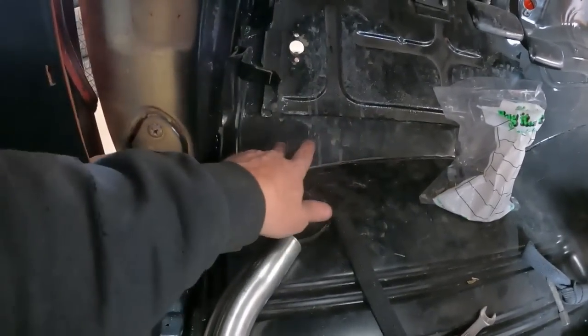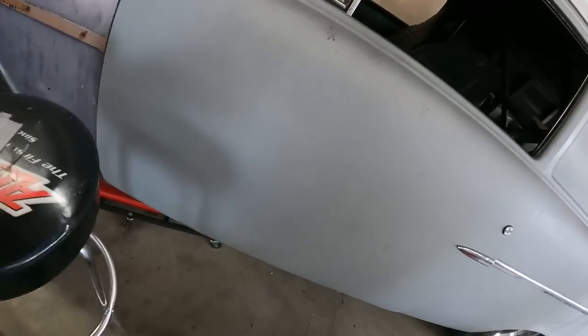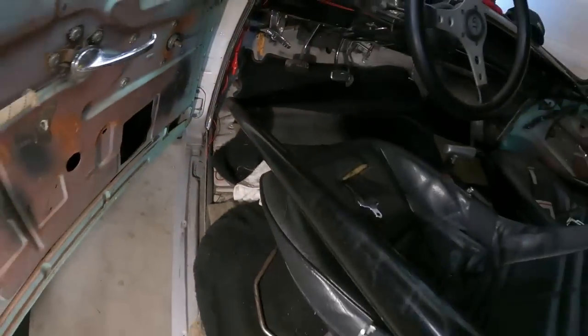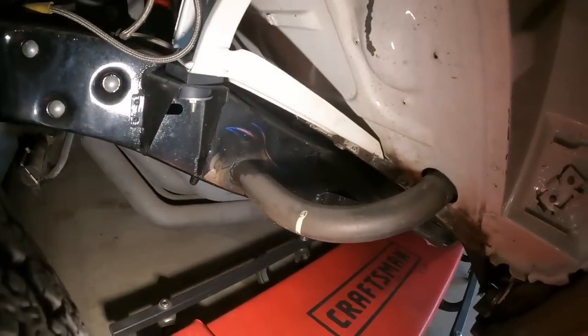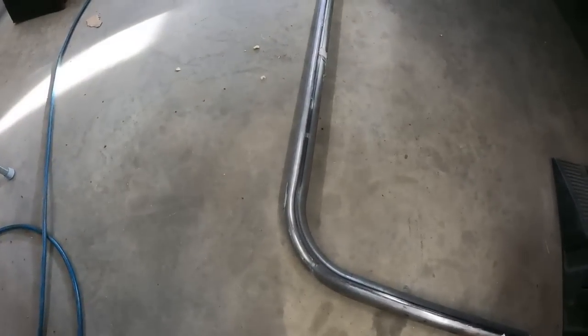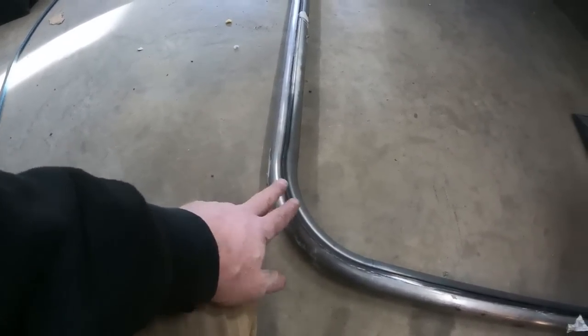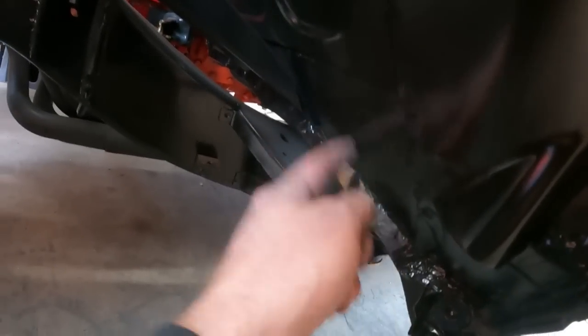With the angles of everything, I'd have to weld an eighth-inch plate and angle the tube. I've got a seam, I've got a body mount — I can't cover that. I'd rather not mount this door bar to the sheet metal even with a plate; I want to take it to the frame. To do that, we're going to drill a hole right here that the door bar is going to go through. Let's go over to the '57 and take a peek — I'm modeling after how they did it there.